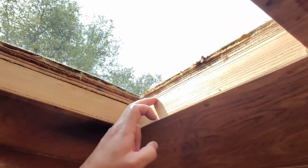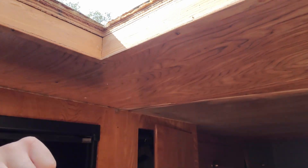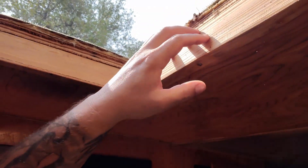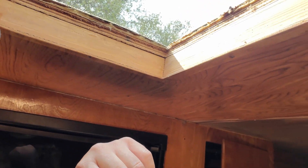As you can see, it's not bad in here — there are these little cracks and stuff. What we want to do is seal those off. You could silicone them, but I'm going to use some ducting tape, run it along there to seal those holes and cracks. That way when the air conditioner is in, air isn't escaping anywhere — you want it all to come down in here in the trailer.